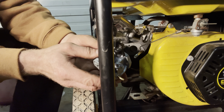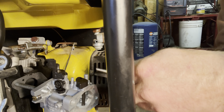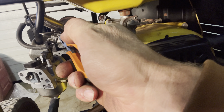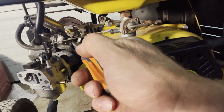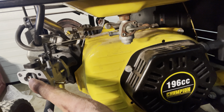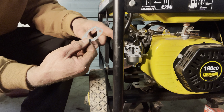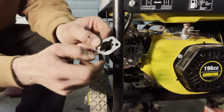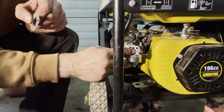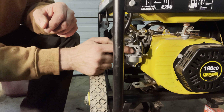We're going to throw the new carburetor in place. Basically, you are going to turn it like that until you can slide the linkage in place. Then we're going to hook the spring on here — try not to stretch the spring. Now we can shove the carburetor the rest of the way. Put the gasket from the carburetor to the air box. There's a little notch right here that lines up with this hole, and a little notch here which lines up with that. This is the way the carburetor goes on — make sure you don't plug up those holes.